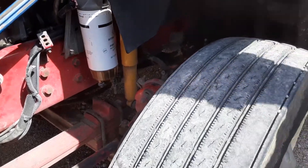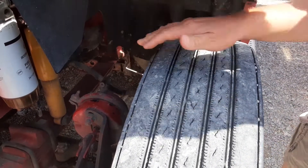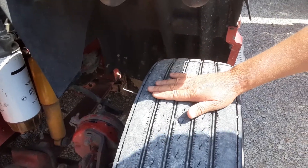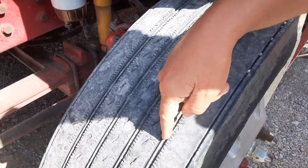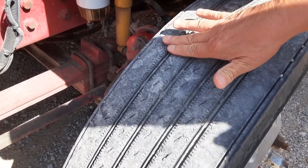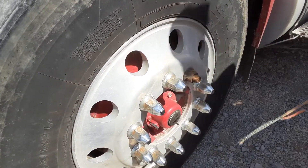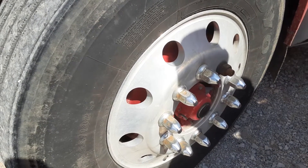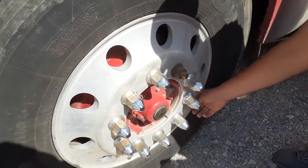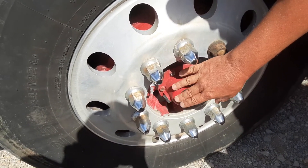Now onto the tires. Check the sidewalls of both tires at the same time — no cracks, no cuts, no bulges, no tread separation. Make sure the tire is evenly worn and should have at least four thirty-seconds tread. There is a wear bar right here — most steer tires will have them; if it gets down to the wear bar you're right at four thirty-seconds. The bead is securely seated all the way around the rim. Check the rim for cracks, bends, or welds. All ten lug nuts are in place and tight, no rust streaks to indicate looseness. Check the valve stem — should have a cap, it's not broken, not leaking, and check with a tire pressure gauge. The hub oil should be full and not leaking.